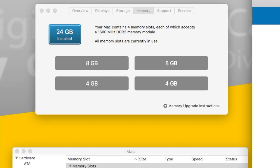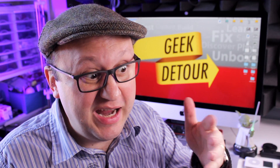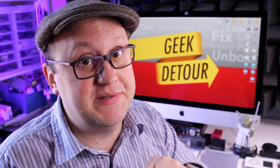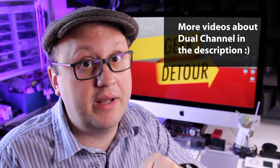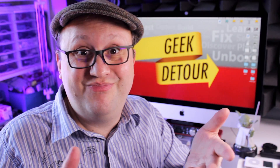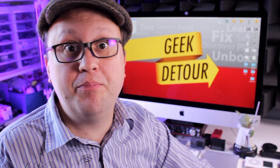This is how it looks on the system information, and this configuration runs on dual-channel. I couldn't find any way in macOS itself to see if memory is operating in dual-channel or not — I confirmed it by running a benchmark and measuring RAM transfer speed. If you know another way, tell me in the comments. There is a big debate about whether dual-channel is really so much better than single-channel. But even if the difference is not huge on all applications, why would you run your computer in single-channel mode? Just buy the correct memory sticks in pairs, put them in the correct order, and get the best possible performance.